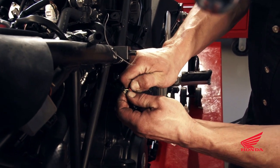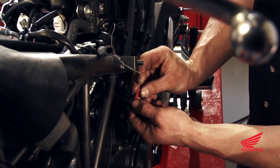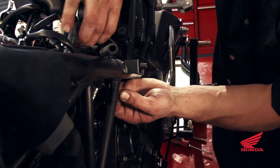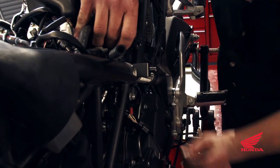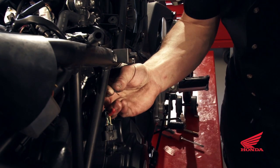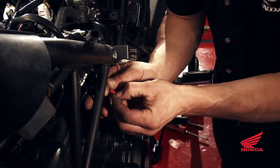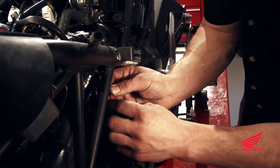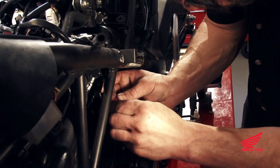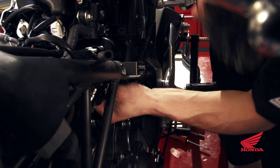Just snug it up — if you go too tight you'll cut the wire, but if you go loose you'll have a loose connection, so go by feeling, then unscrew the back. Route the gray wire from the DynoJet box in behind the frame, bring it back out to connect into the PosiTap, slide the red connector over the gray wire, and screw that back in. Now your gray wire is connected to your yellow wire. Go ahead and plug the TP sensor back in.